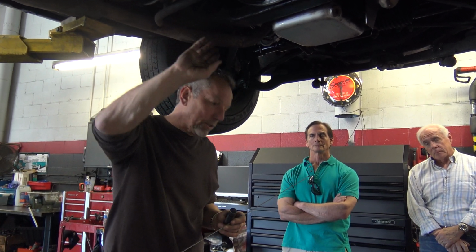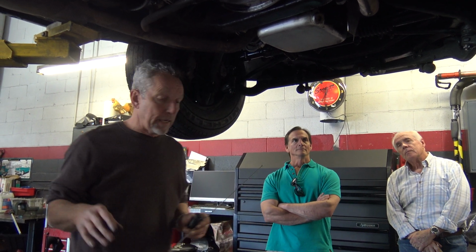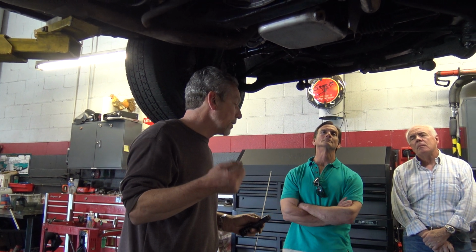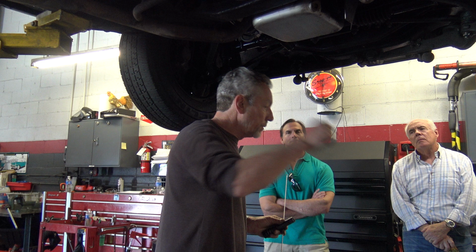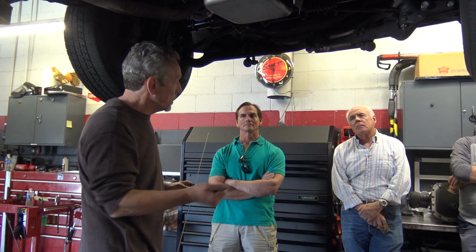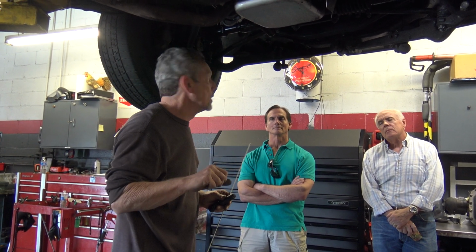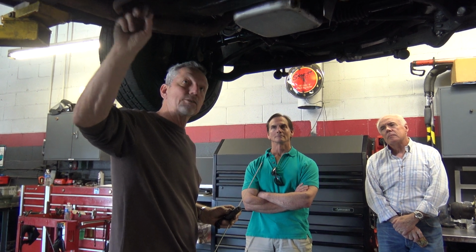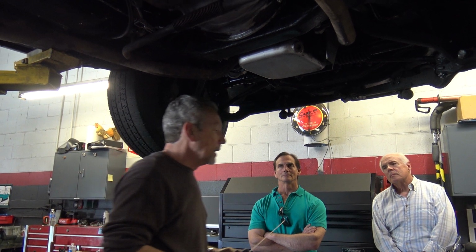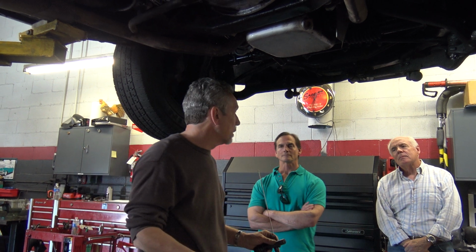This is part of the EGR system, which reduces that NOx I talked about. And the way that does it is when you give the car gas, it's more likely to not burn everything right. So when you give it gas, you're dumping fuel, dumping air, and your timing is supposed to advance. Advanced timing causes pre-ignition. That's that NOx gas. So what they do to correct that is they take exhaust gas and pump it in with it. And it affects performance because you're pretty much diluting the mixture.